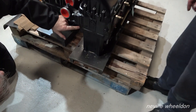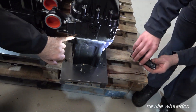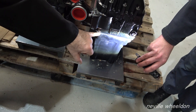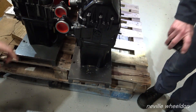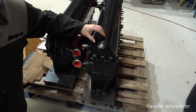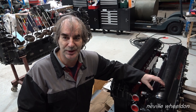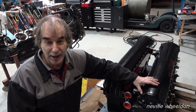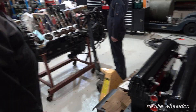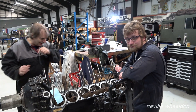Looking through here you can actually see where the studs would go — you can see the hole and the threaded bar where the studs would normally be. These are exposed to the atmosphere. The original studs were coated, but of course 60, 70 years on the coating's come off. When Rolls-Royce put the coating on in the 1940s and early 50s when these engines were being built, it wasn't a concern — the engine was going to be used and then stripped, not left standing for 50 years.